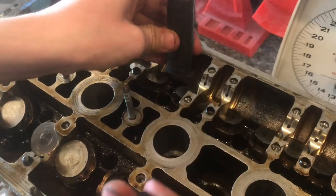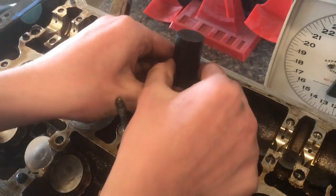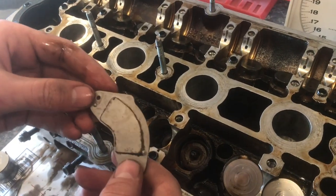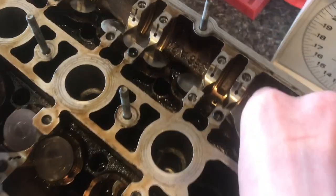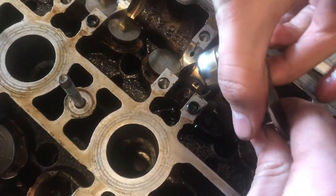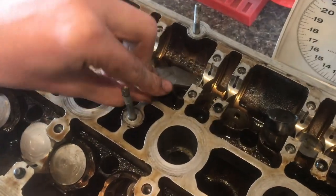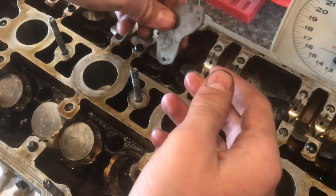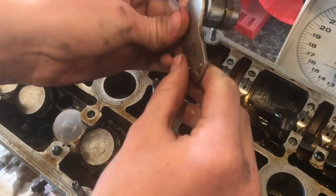Let's remove the smaller one. Here's a really strong hard drive magnet — it's a neodymium magnet. That's really going to grab a lot harder. Pull straight up and you can see that got it. Now let's try the one that was giving us more problems. You just got to get it flat on there so you have the surface area, and then pull up.